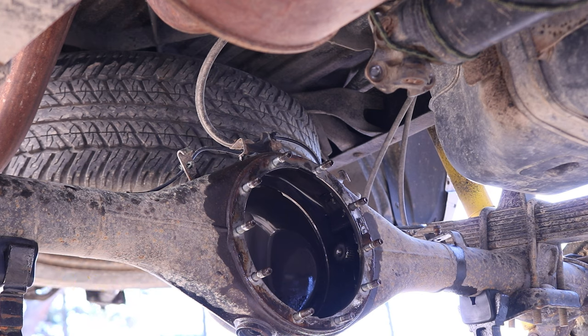Definitely disengage the e-brake when reinstalling the wheel hubs. This allows some movement in the axle so that the splines can line up. You would need to lift that hub just slightly in order to do so. And we'll do the same thing at the opposite side.